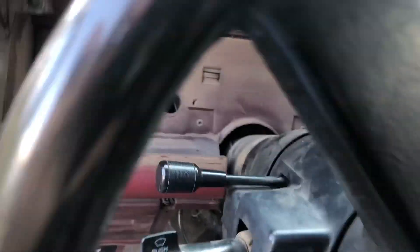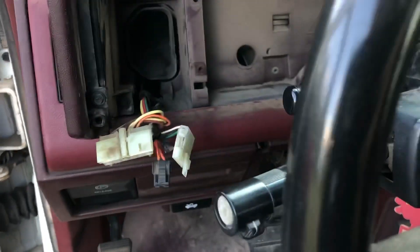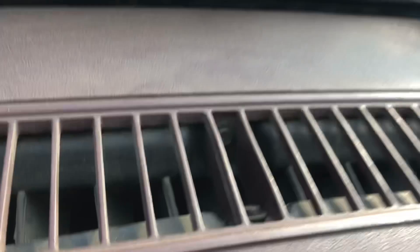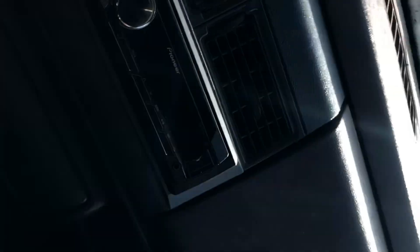Now to get most of this stuff out here, it's pretty easy — you don't really need to watch this first part. Everything here kind of just comes out. Now I'm going to start working with the harder stuff. I can take that out because it can come out easily before the dash starts getting loose. There's one bolt here, one there, one there, and one there — three seven mils, pull them out. If you don't have a single DIN deck in here and you still have the cassette, it's a little bit harder with that cassette. But it's easy if you have a deck. Pull down, pull back, and undo that harness. So I got the radio out.